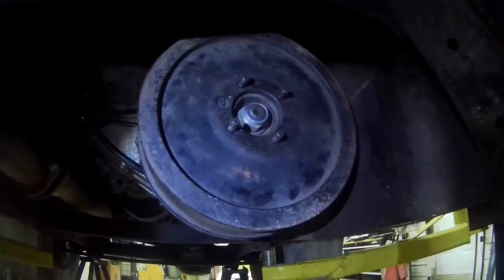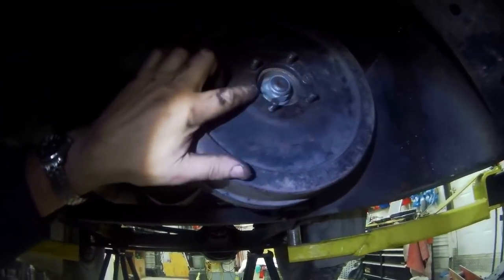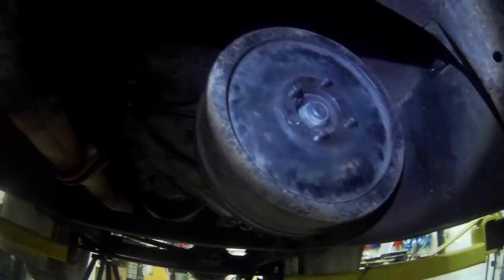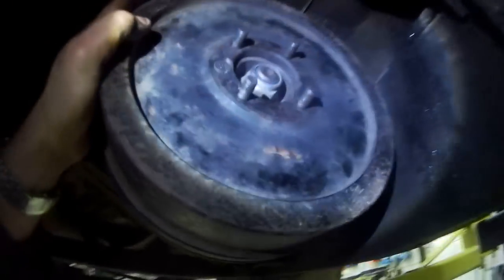Once you're happy the shoes are in, you can put the drum on — that's really easy. Put the screw on. Again, these bolts are not evenly spaced — they'll only go in this way or this way. So the next thing is to do the adjustment on the shoes. Now these are new shoes — they haven't settled down properly, but hopefully I can show you how to do that. What I do to get the shoes right is tighten up the drum and then with a hammer I'll just shock the drum a little bit like this. What I'm trying to do is center the shoes because they could be dropped a little bit — so what you're trying to do is shock them into the right position.